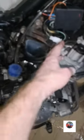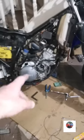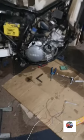Get the exhaust on. It's ready to start, it's sparking, everything's done. I've still got to join them extender, put another plug on there to here. And that's it, all this is wired up. The CDI's out the way now, which took them wires up there with a cable tie. Get the oil pump casing on, then it's done.